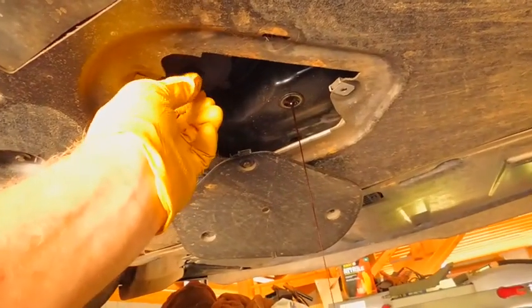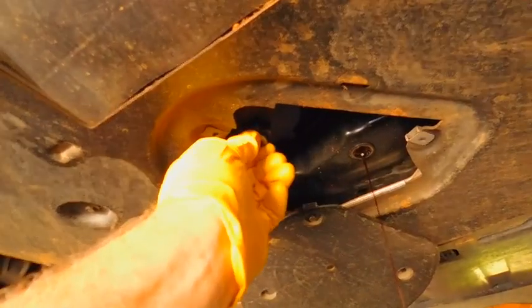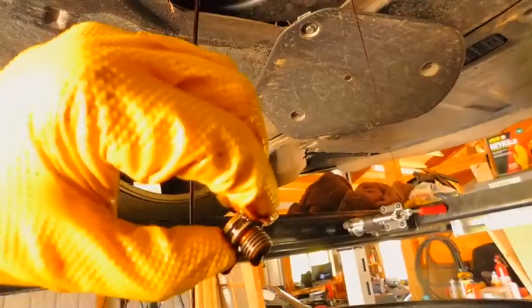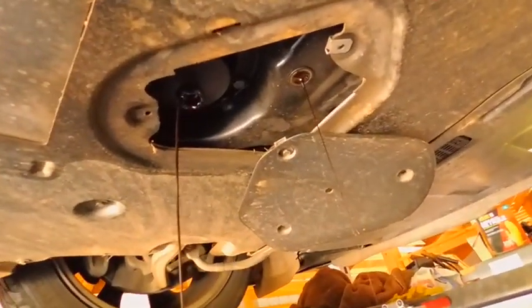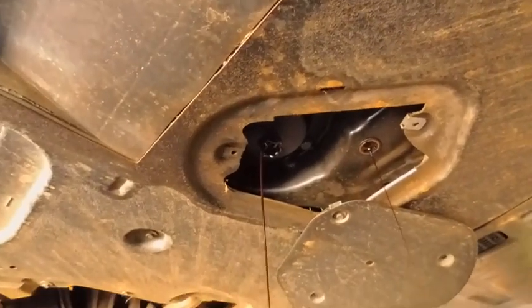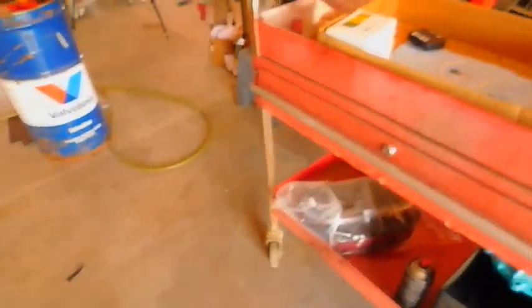And that O-ring does hold you up. It makes you feel like you're stripping it or something, but be sure and have your seal glide ready, and you get that out of there. Doesn't seem like much, and there's where that little ring goes, right there. So let's take all the gaskets off and throw them in the ultrasonic cleaner and clean them out. Just let this drain. You won't make near as much mess taking this oil filter cover off if you do this. And you need to change that O-ring now and then anyway. So now's the time. Just do it every time.